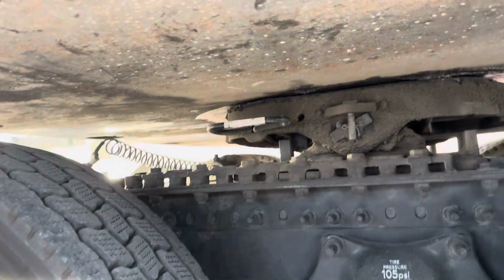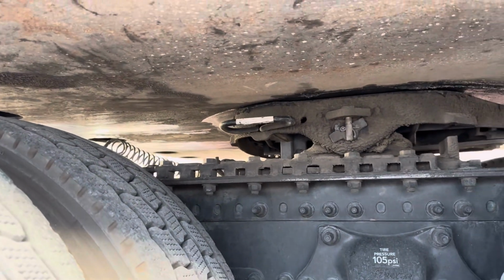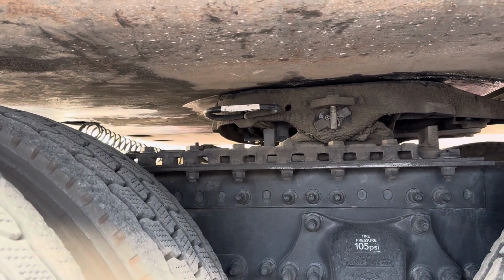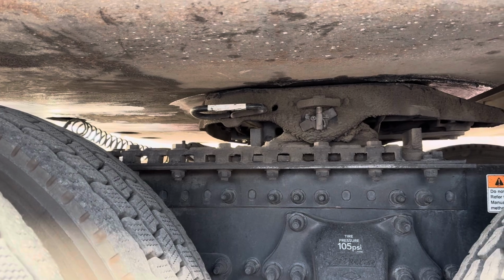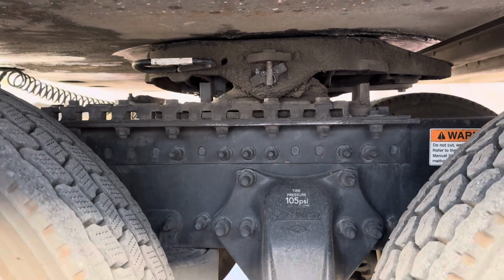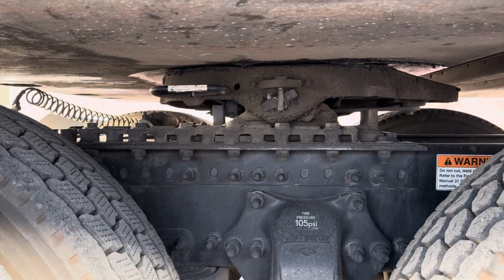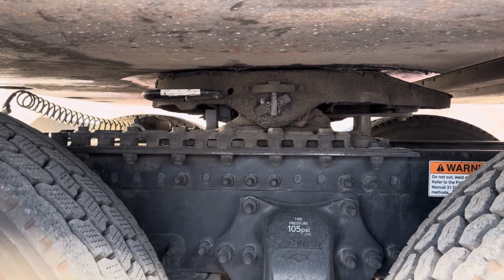My release arm is properly mounted and secure, not cracked, dented, damaged, or broken. It's in the lock position, and my safety latch is in place. My platform, which supports my fifth wheel skid plate, is properly mounted and secure, not cracked, dented, damaged, or broken.